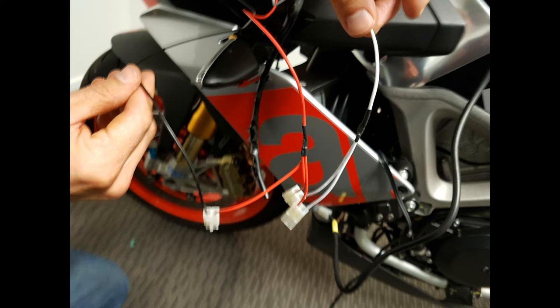But the plugs that you've actually got, you would think brown and blue, right? Brown and blue. So what are we going to have there? Brown's going to be live, blue's going to be neutral, right? Nah. So don't even think about trying to make a mistake here. Blue was positive and the brown was neutral, right? So the spuds that put this together clearly have no concept about what live and neutral means. It's a bit disappointing.